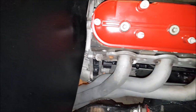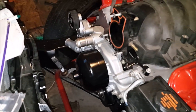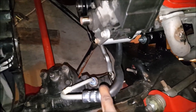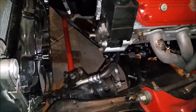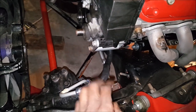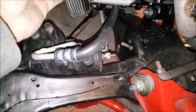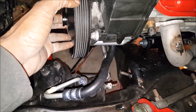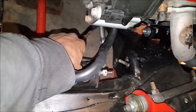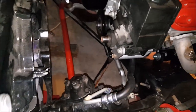Got the starter down there — it fit good, I can pull it in and out with the headers in place. Got a few of the accessories on: water pump, power steering pump. Got a new power steering hose from a 2002 Camaro, whatever fits — it fits pretty good in here. Had to bend it over a little bit because at first it was too close to the pulley. Bent it over to give more clearance, so once I get it tightened down it'll be fine.